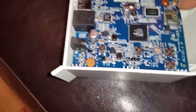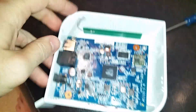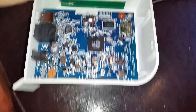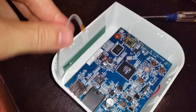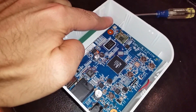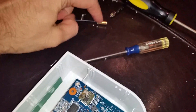I'm going to put you on pause here while I disconnect this internal antenna by jiggling it around — that's all I'm going to do right now. I just wiggled it and it pops right off. So my next goal is we're not going to use this internal antenna anymore. I'm going to drill a hole through the case with a regular drill and then plug the pigtail connector in there.